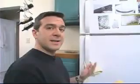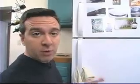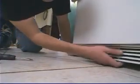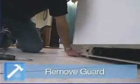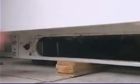Which brings us to the next step. Does the door shut on its own? If it's not, it might be because the fridge is tilted too far forward. So how do we tilt the fridge back? The first thing you want to do is take off the plastic guard on the front of the fridge. Once you've got the plastic cover off, have someone else push back on the top of the fridge so you can lean it off the legs, and use a piece of wood or cardboard or a book — something to shove under there and wedge in to get the pressure off the legs.